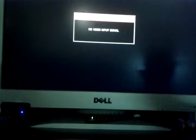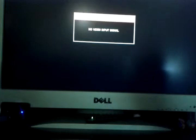Now, with it in factory service mode, when you boot it up, there's not going to be any output on the screen. You're just going to see your flash drive start blinking. And that's possible I have the wrong pup on here. I didn't check that before I put it in there. If anything goes wrong, your green power light will start flashing. And it also starts flashing right before it finishes the install, and then it shuts itself off when it's done.